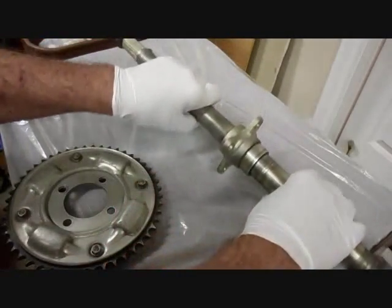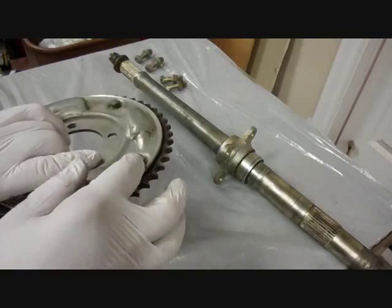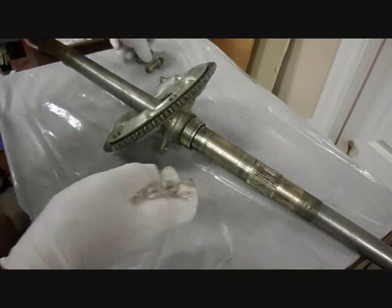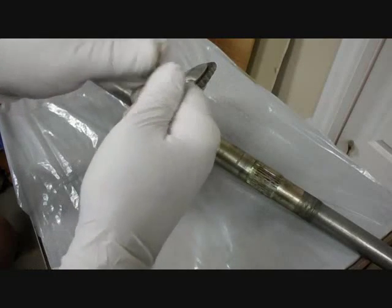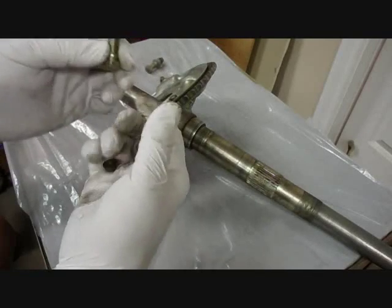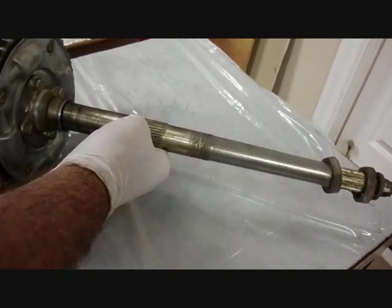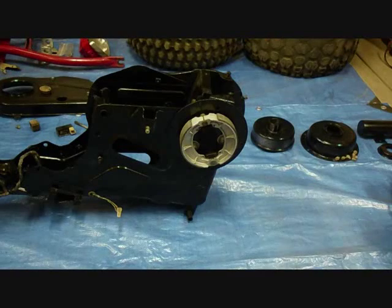Alright, now we're going to put it on the axle. It goes on the left side with, I don't know if it makes any difference or not, but all the nuts faced to the outside on the left. Okay, and we're going to secure it with these very strange looking bolts. The bolt is threaded for 2 different size nuts. We're going to use the large one now to secure it on, and it'll face the same way as the little ones. Now that we've got everything cinched down here, we're ready to install the axle, and that'll go in from the left side, so we'll have to take all these parts on the right hand side off. Okay, and off the axle.